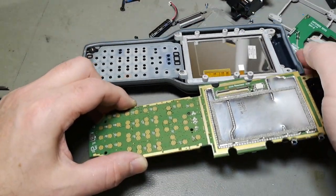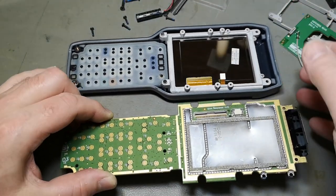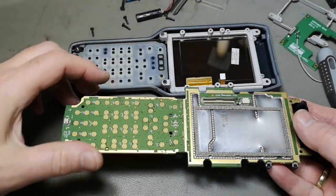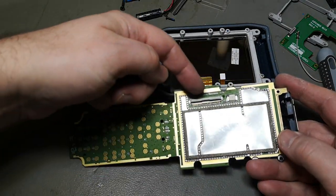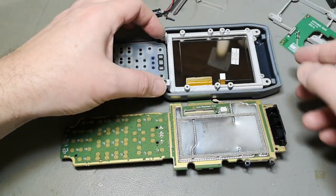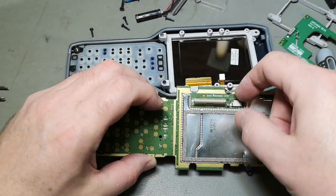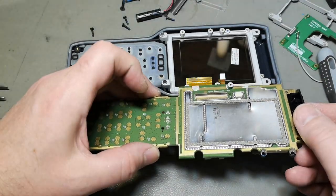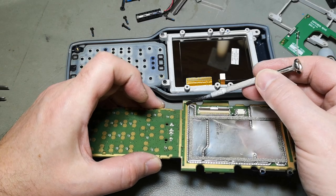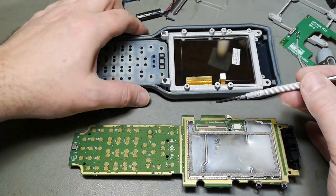I think I have actually understood how to assemble and how to disassemble that. And I actually did it wrong. Because as you can see here, the two connectors to the display and to the touch, I kind of just pulled them out of their sockets. The idea is this piece of aluminium is supposed to be here and then lift it all together in like one sandwich. Otherwise, you can't connect the touch and the display interface. But now you see again all this leaked acid is also here and very close to the display. And yes, we did see some display flicker, right?